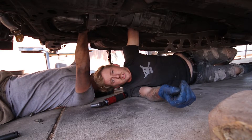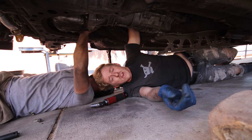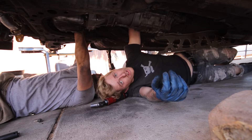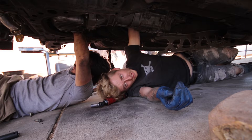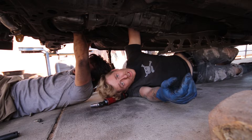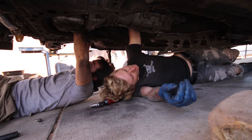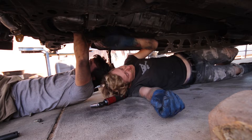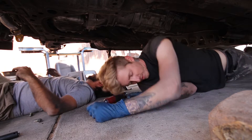It took two different attempts to get this trans back up. The first time the clutch felt like it slipped out of alignment when I was torquing the pressure plate down. We fought, lost — took it off, re-torqued it, re-centered it. Fought again, lost again. Third time was a charm — we basically just sent it, rammed it in; we were both tired and pissed. Now we're just tightening the bell housing bolts.